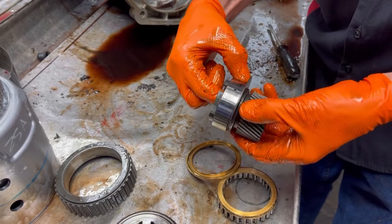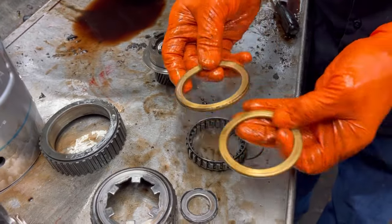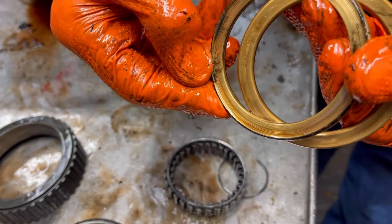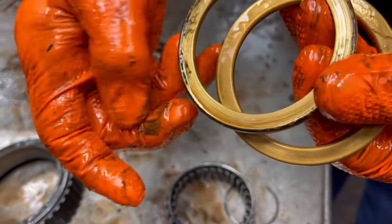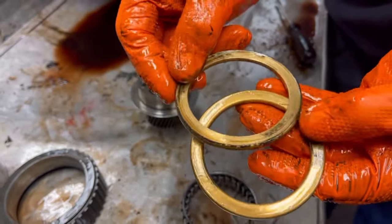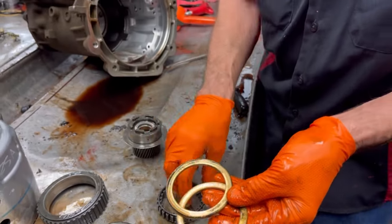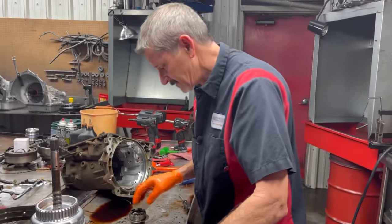Look for any chatter marks — it looks really nice. These washers just wear. You can feel that lip — see that big lip right there? It's about 40 thousandths compared to this one, which is brand new smooth. These look the same when you put them in there. Now the new one we come back with will be a dual cage and it will have metal guides for the washers.